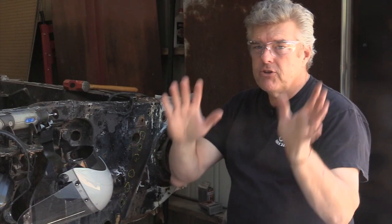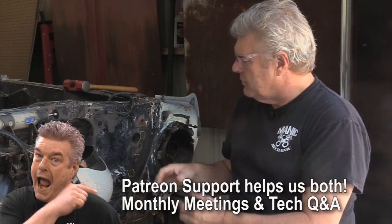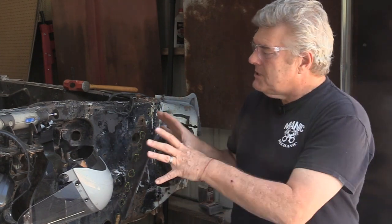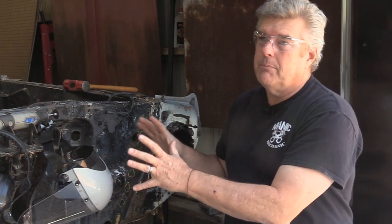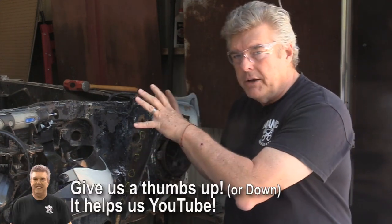One of the first things I'm going to talk about is the fact that we did not put the jack stands on here initially when we were doing most of our spot weld cuts. We do leave some spot welds in position so that the chassis won't move around much before we put it on jack stands. But sometimes if you're doing this on a weekend warrior basis, you're not going to get all these spot welds cut away in a weekend. You may want to keep that chassis mobile until the last second before you start setting everything up to take the radiator core support off.